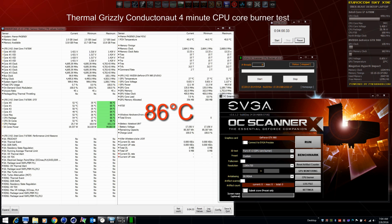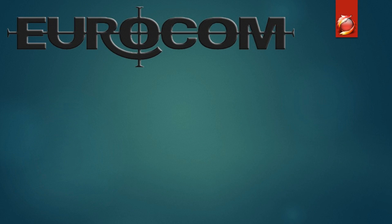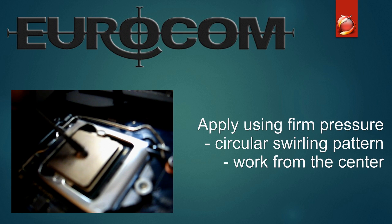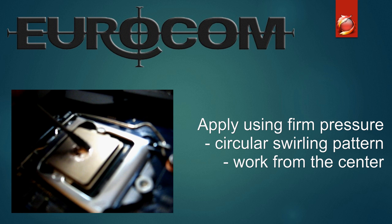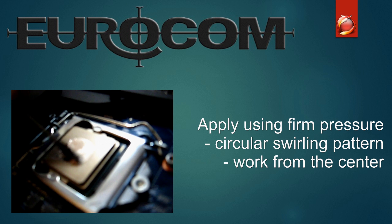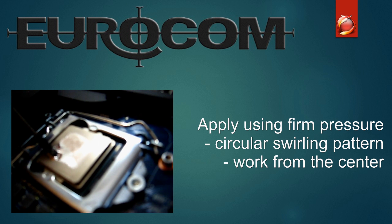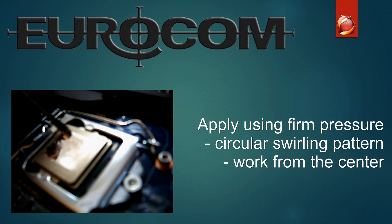As you can see, there are distinct advantages to running a liquid metal thermal paste. The liquid metal needs to be applied differently than a normal thermal paste. Here I'm working with a small dot in the center, in a circular motion working towards the edge of the CPU. We apply this same technique to the heat sink as well — it's important that both halves come together wet.